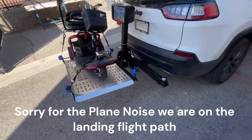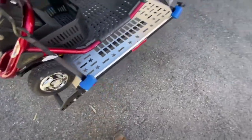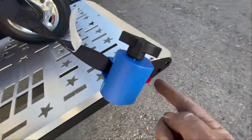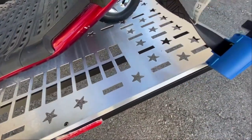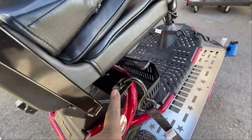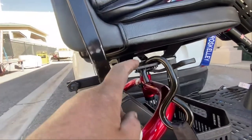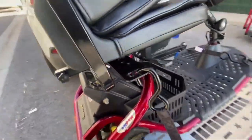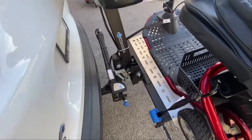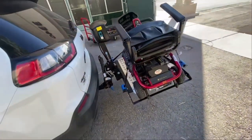That's installed — this is the AL300. The only difference is these ratchet straps — quick-release ratchet straps. Press this red button just there and it releases, and just give them a quick turn and that tightens it down. With the kit you also get this seat bracket that bolts under your seat, bolted to the frame of the seat, so you can hold the back of the seat down to stop it jumping off on either side. Everything else is the same on the lift apart from the lockdown arm, which you don't get. Safety pin in, and that's it — all done and installed.